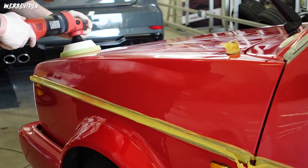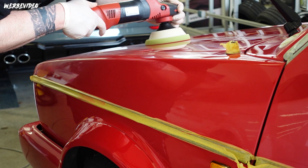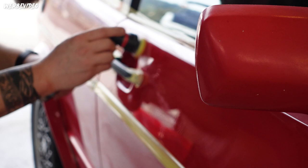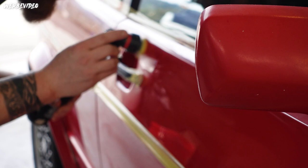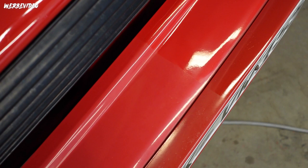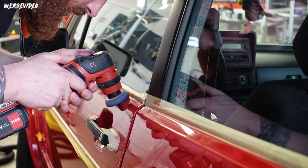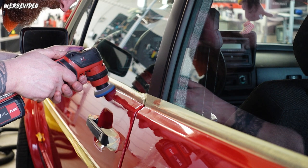You can see the 50-50 comparison on the trunk lid too - very, very good. Then we're back to driving the finish. The finish is done as promised with the Polytop Reflex, also rotary on a soft pad. A rotary finish was important to me because on this colour it really comes across beautifully - it's a uni-red. On the front bumper there's also a short cutting comparison. Also, the grille was already half hand-polished - if you missed it, scroll back and take a look. Before degreasing there are a few fine details to address using the detail sticks, to really get into every nook and cranny, because on older vehicles every unpolished crevice stays grey and will be visible.